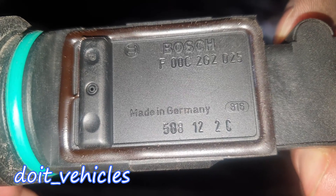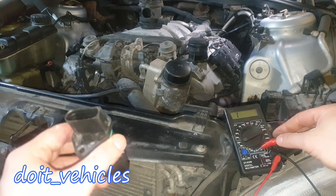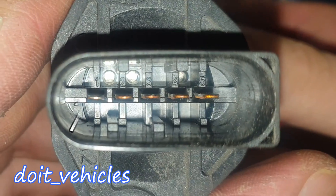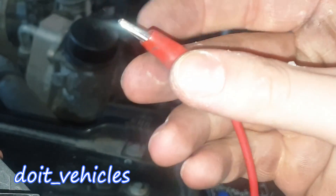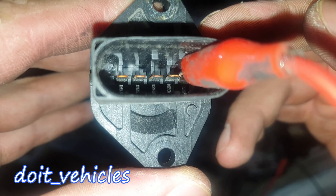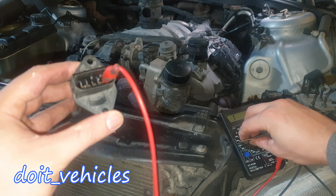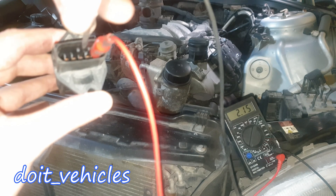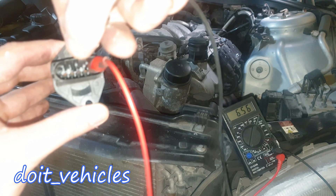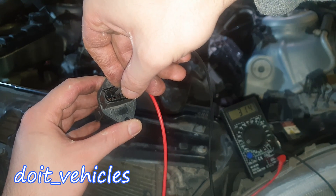Here you've got the part number if you need it. Now once you've got the component out you can do a bench test - using a voltmeter, the only thing you can check is the resistance between the pins. I've got the voltmeter turned to 2 million ohms. Inside there you can see pin number 1 - I'm going to start from that one. Between pin 1 and 2 we've got nothing. Between pin 1 and 3 we've got 2,150 ohms. Pin 1 and 4: 6,550 ohms. And between pin 1 and 5 we've got around 315,000 ohms.